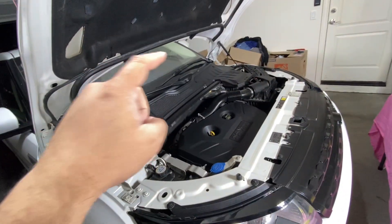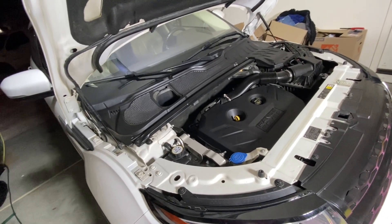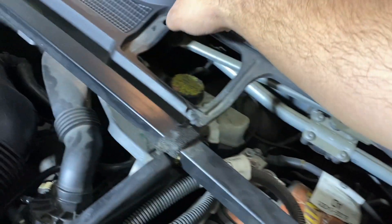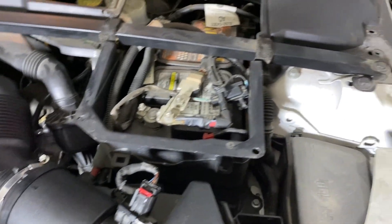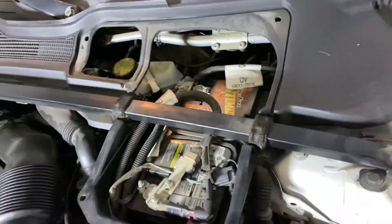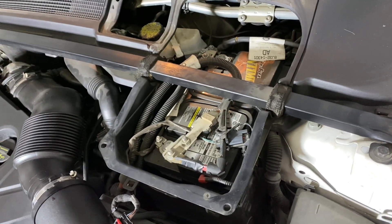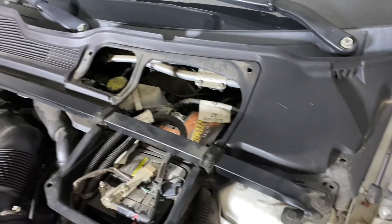What we're going to do is disassemble the cowl, take the two wiper blades out, and the battery box. I'll link the tools. We just removed all the plastic covers and pulled the plastic boots off — those are 15 millimeters. We're going to take the strap brace bar off; those are held on by 13 millimeter bolts. This is my first time doing this, and no one else has a video on it, so bear with me.